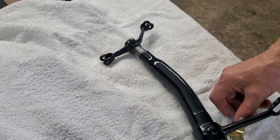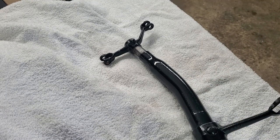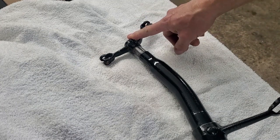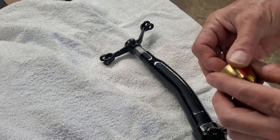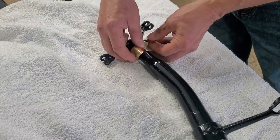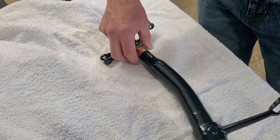So here's my brake cross rod or cross bar, I don't know what it's called, but I got the old bushings off, which I think were original to the car. They were very similar to what the steering column bushing was, had that wick in there that was soaked with oil, but they were shot. Didn't want to get involved in taking these off, so I bought the brass split bushing. I guess they're pretty commonly used. Luckily my shaft is not worn. So I got a good fit on there.